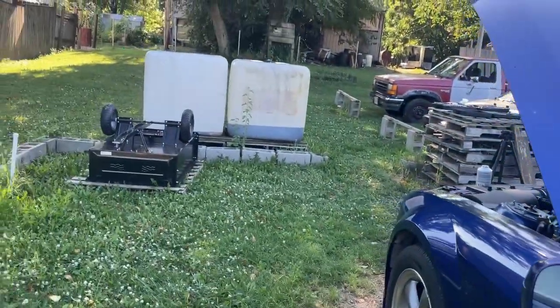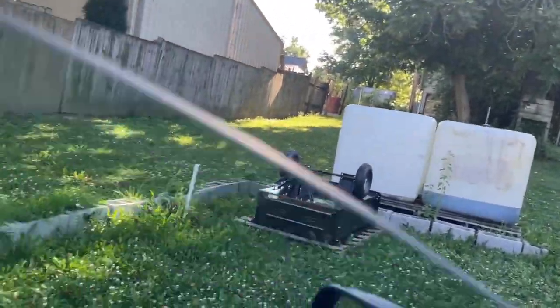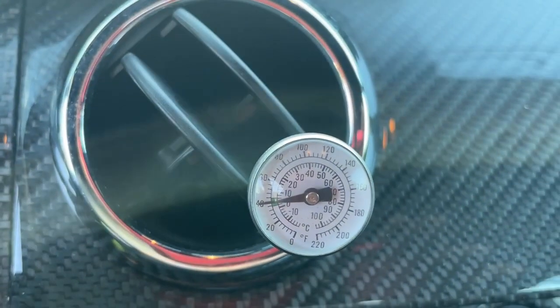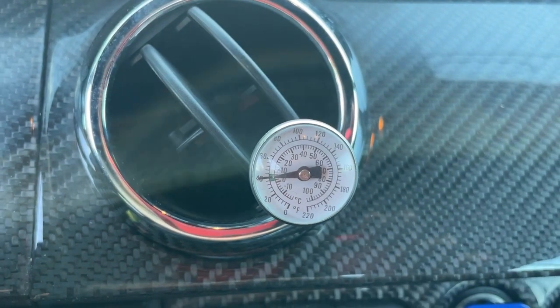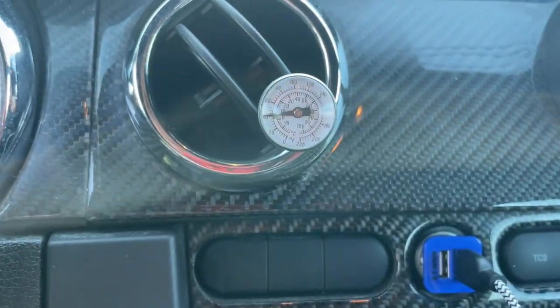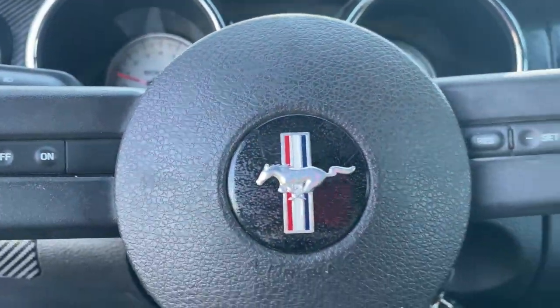We only put an ounce in it, so if we need to, we could put another ounce in it, but I don't want to put too much in it because I don't know what's left in the system. Look at that. Two cans were within range. All right, look at that, folks. We are within range on our Freon. We only had to put two cans in it.